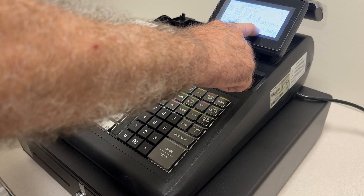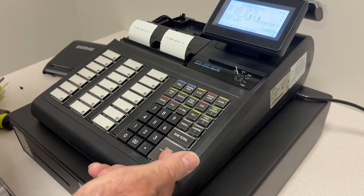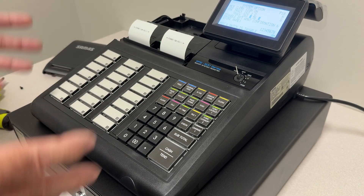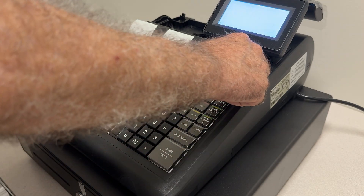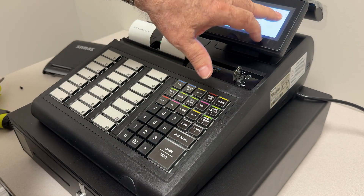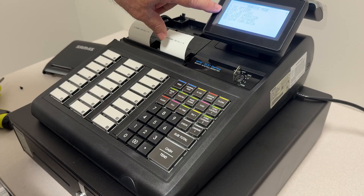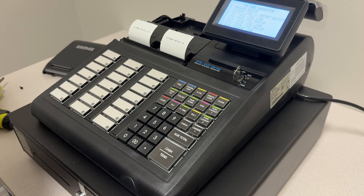As you can see, we now have one through eight as our store name. We simply hit the cash key to set the store name. So we have eight digits — you can call it whatever you want, but remember you need eight digits. Once that's done, we can simply turn our key down to service mode. You'll see an arrow indicating another page, so press down and you will see that SD card operations is number nine. Press nine to go to our SD card operations.